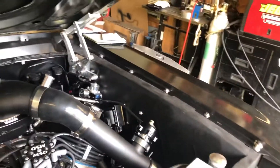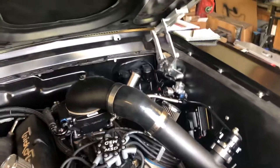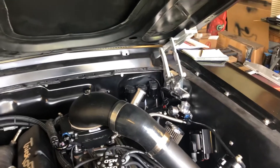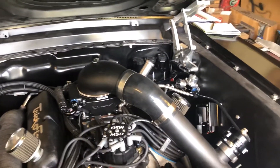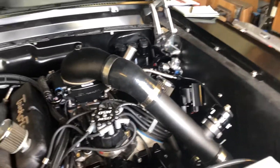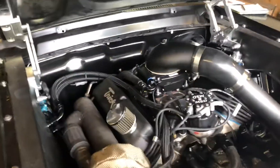That's how you phase a rotor. For anybody that's curious, these MSD Pro Billets can be used for timing control — you just gotta lock them out, just like you would with any other MSD timing control box. Lock out the rotor. I'm not gonna go through how to do it; there are videos and instructions online. Holley has the instructions right in the Sniper instructions — read the Sniper instructions, people. They go over so much.